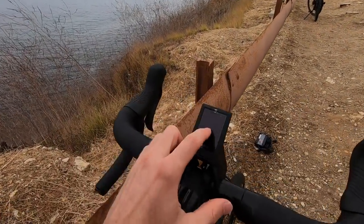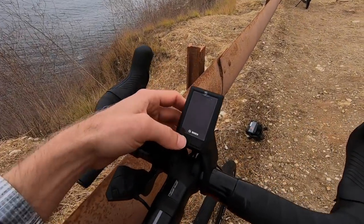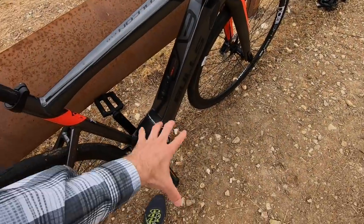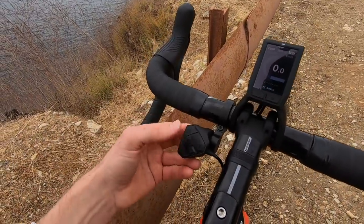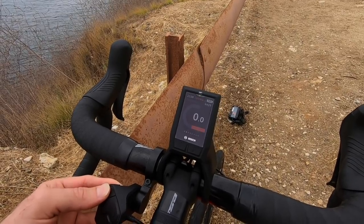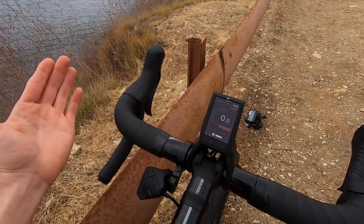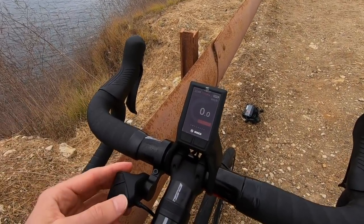There are some pretty cool options. I like this display — it's got Gorilla Glass, it's color, so from pretty far back you can sense what's going on without having to read it. Powering it up now — Kiox comes to life quickly. It's asking about an update; we'll skip that. This is 'off,' the lowest level of assist, just like a regular bike — designed with no friction. Pressing the plus or minus keys goes through the different levels of assist, you can see the color change: Eco is green, Tour is blue, Sport is purple, Turbo is red — up to 340% assist. There's a spiral graphic that fills in showing how much work you're doing versus how much the bike is doing. There's also a percentage indicator on the battery infographic — much more precise than just five bars.